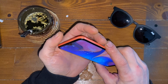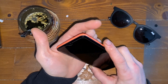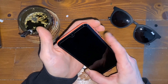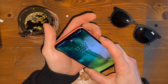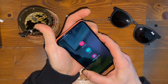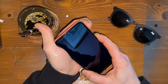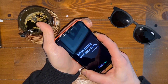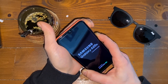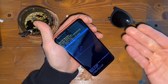To do that, press the power button and volume down button, and as soon as this resets, press volume up button and power button. Let's do that. Power button, volume down button. Wait till it turns off. Sometimes it can take multiple times to boot it, but sometimes it boots with the first time, like this time.